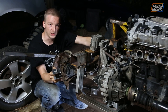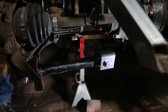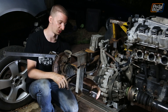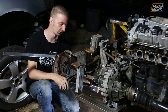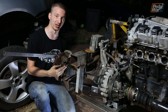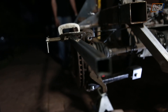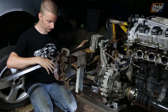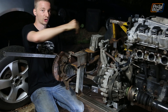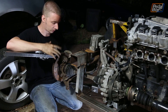We've built our radius arm mounting brackets — it's now dark and it took a lot longer than expected. We can now get these onto our shortened lower radius arms. To attach these brackets to the chassis we need to know where they attach, and for that we need the hub in the right place. To get the hub in the right place, we need to compare it against the rest of the body. We've clamped a big piece of stock down the side of the bodywork attached to our brake disc.